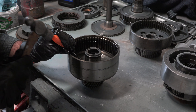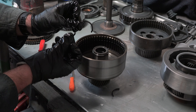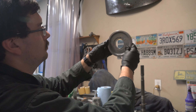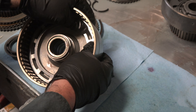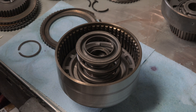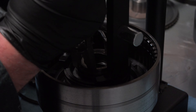I had to bust both of the old O-rings off with a pick to even remove them. After cleaning and inspecting all my parts, I put on the new O-rings, lubed them up with transmission fluid, and then slid my piston back into the drum. I then placed the spring and retainer back on top of the piston, compressed them down, and reinstalled the C-clip.